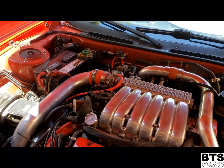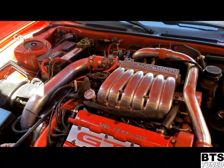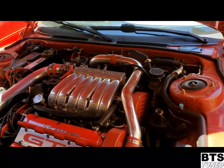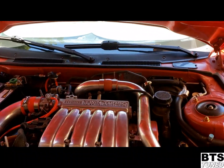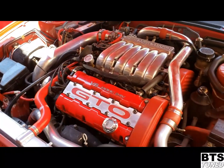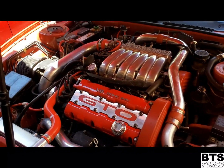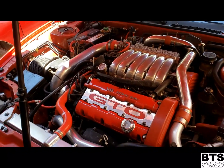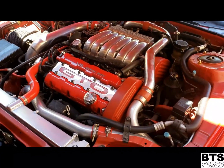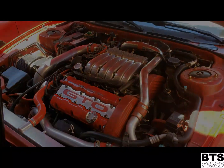replace the leaking throttle body with a rebuilt one with mil-spec shaft seals, and any other little issues that come along the way. Do a booster line reduction, have them join together, clean up a bit, and then slowly do more. I'm going to adjust the clutch pedal with the Clutch Masters 850 Street twin disc, possibly bleed it more, and yeah, take it slowly, step by step, documenting along the way. So hopefully you guys enjoy this.